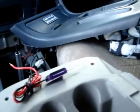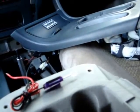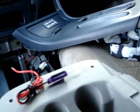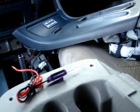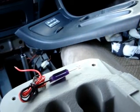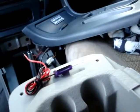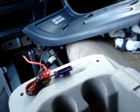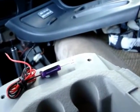I've got four LEDs and I'm running them all in parallel. They're 5-volt lights each. And if I understand the method correctly, I will draw less power using a straight 12 volt setup rather than 5 by 5 by 5 by 5, using 20 volts, 5 for each light, whenever you're running them in a series. If I run them parallel, I only need 12 volts and just ground each light out and run them all in a big parallel circuit.